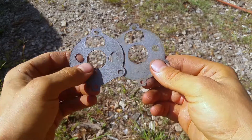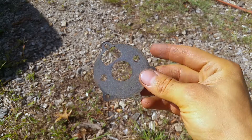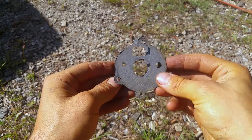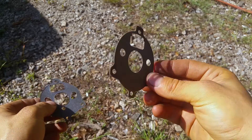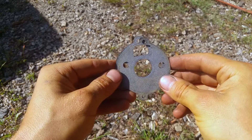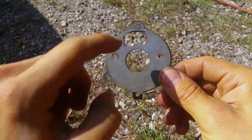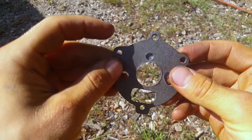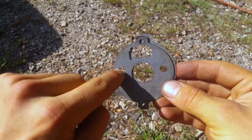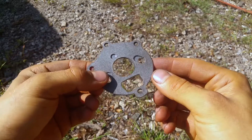You double up on the gaskets. You can see here this is the original gasket that's supposed to be on there. The guy didn't have the exact same one, so I had to enlarge these holes here — it's not really going to matter because of the way it seals. If you do this, make sure you get the right one. I'm just concerned about sealing around here because that's where it leaks from. I had to modify it so the gas passes through, but it has to seal good right here where these holes are.